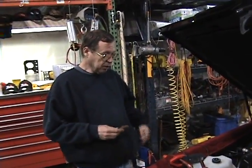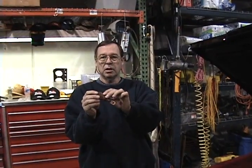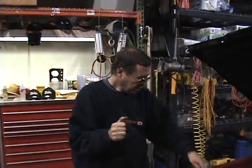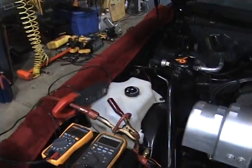To really remove all doubt, on the end of the alternator stud I have put an adapter with a huge piece of copper stranded wire, so it makes a really good joint for the big jumper cable to get a grip on. The jumper cable is one gauge and it has solid brass connectors on each end. So this is a very substantial connection — there's the other connection on the other end.